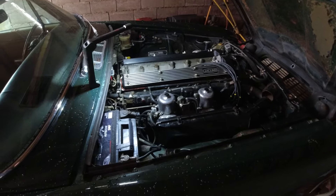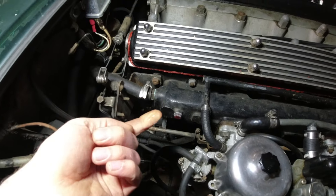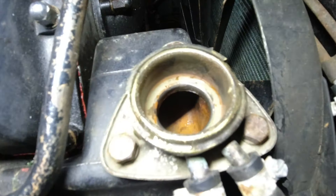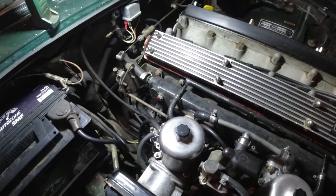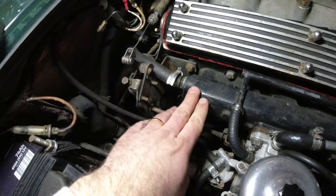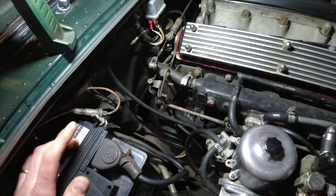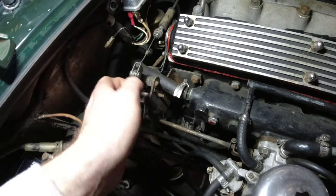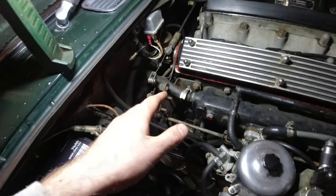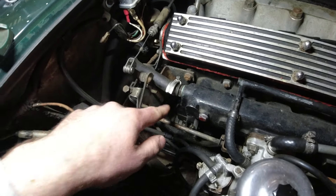We're in my little carport here — my workshop is full of customer cars. Here is where it's always been a little bit wet. You can see coolant there on the bottom; we lost a bit driving yesterday. I have a hose that will fit here. This is a Series 1 intake manifold, so I have to modify the hose a little bit. I'll drain out a little bit of coolant. The new hose is for a V12 sort of thing — I'll have to cut it, but it has a good bend in it.